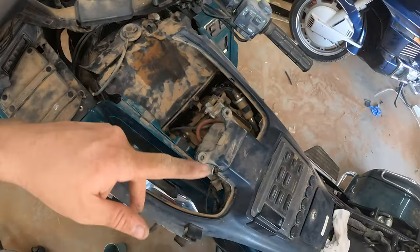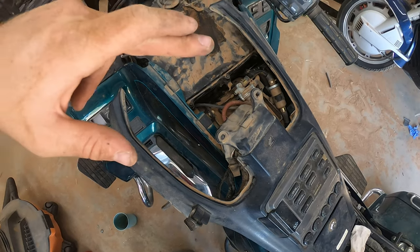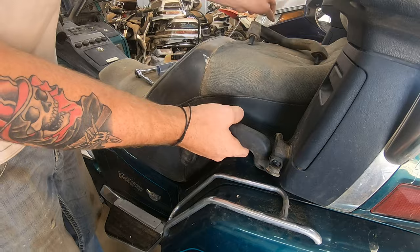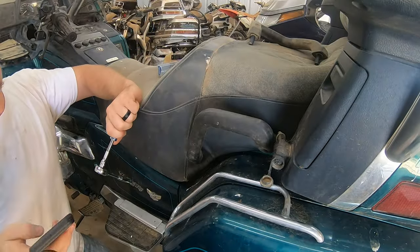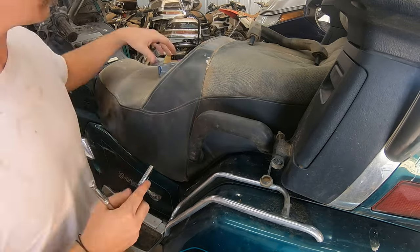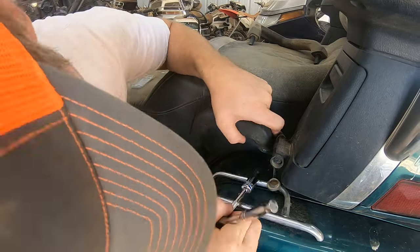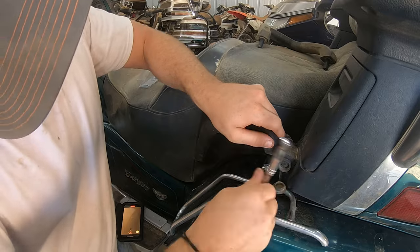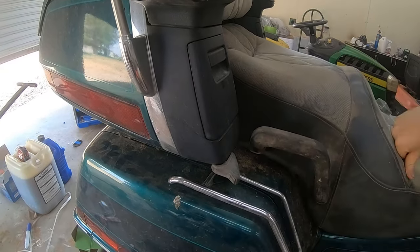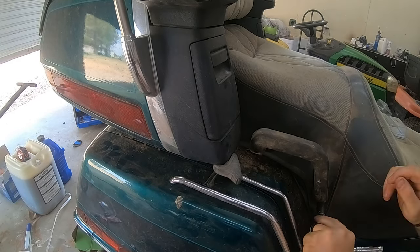One thing to consider before you get all this stuff put back on: if it's been a while, you might change your fuel filter — it's right there and pretty easily accessible. Then you just got to put this piece on along with the two covers that go near the steering stem, and then the seat. Normally your bolts will be Allen head, but the bolts holding the seat to this motorcycle were lost, so I got a screw with the right thread pitch — it's a 13-millimeter socket, which makes it a little harder because the rubber likes to catch on that metal, but we're just making do with what we got. Well, that's all there is to it — we've taken the carburetor off, we've disassembled it, we've cleaned it, and then we've reassembled it and installed it. This is Octane Restorations, thanks for watching this GL1500 tutorial, and you have a good rest of your day.